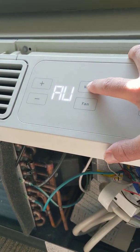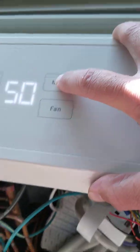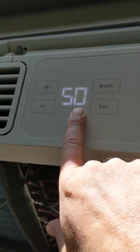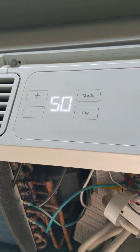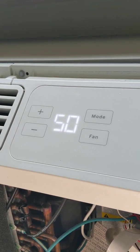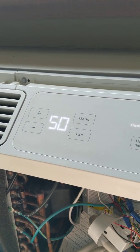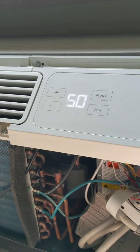You get to AU — you want to see that. There are several settings here, they're all usually listed on the bottom of the GE unit. I'm going to go to five first to show you. By hitting mode I got to five. I've already changed the temperature cool limit to zero, which means I can get this down to 60 now. You want to be careful if you're at a hotel in the southwest or somewhere hot, because if you put it too cold you could freeze up their compressor and cause damage. So be a little wise in how you do this — turn the fan on during the day, or turn the unit off completely during the day to protect the AC unit. Sometimes I'll even set it back to how it was when I leave the room, just so the next guest can't fry their compressor.